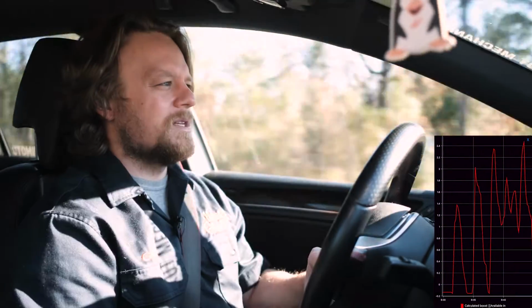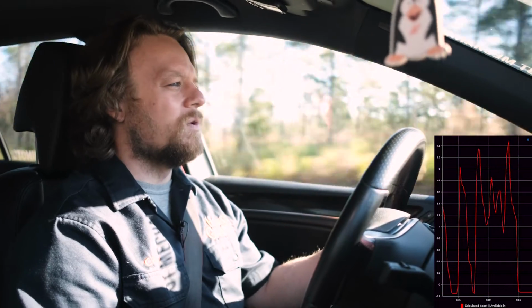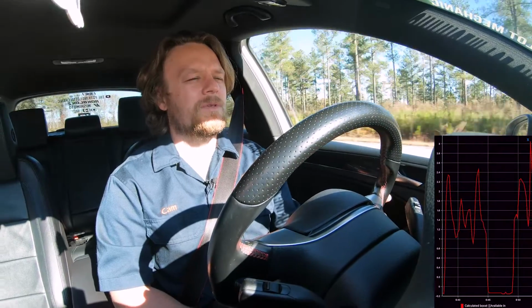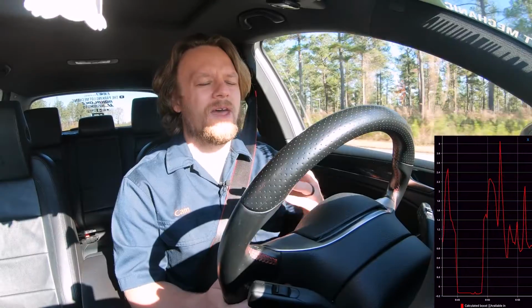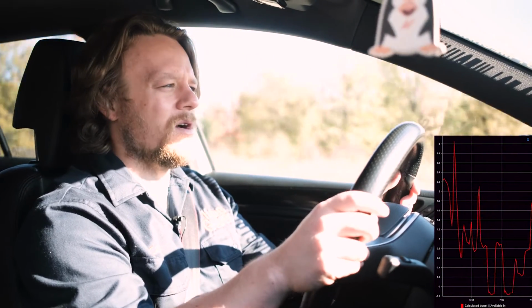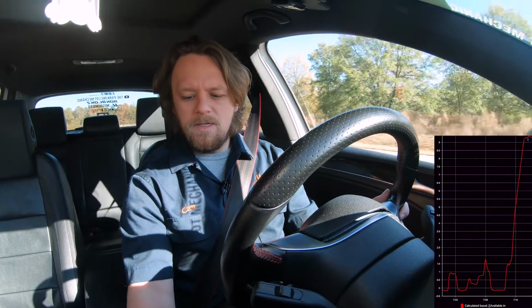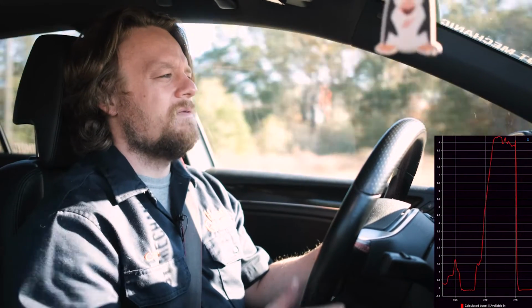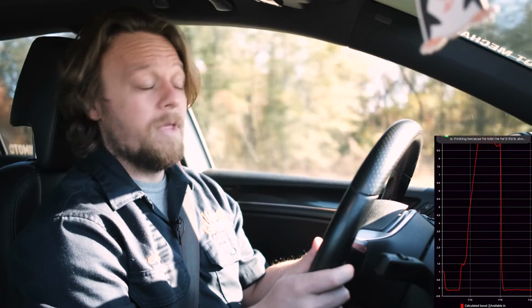So we're still trying to figure out exactly where it is. I got to contact 034 to figure out where they set their boost pressure for the stage 1 tune to know exactly what I'm looking for. But the fact that we're at about 10, that's 9.5 if you want to get very specific, but the fact that we're increasing that is just really good. Very excited that we're making progress. This might just be an ongoing saga to get that boost pressure back, figure out where everything went. One last one. Yep, 9.5 it is. Not bad.